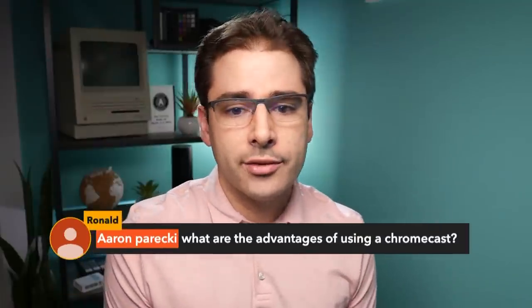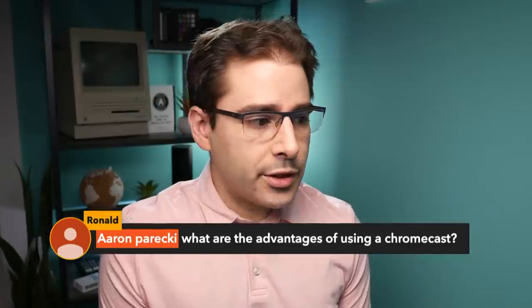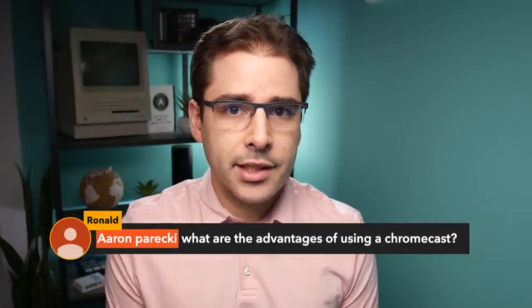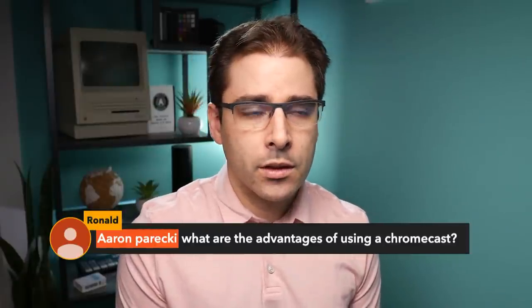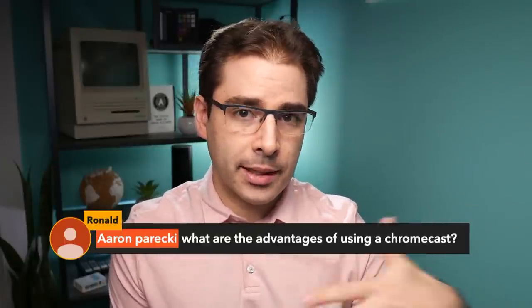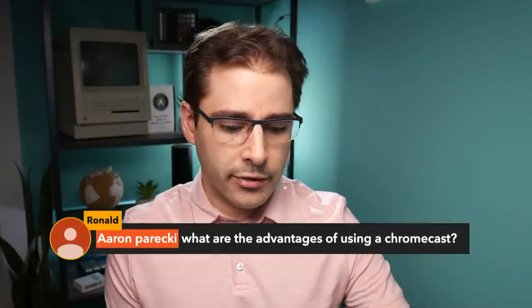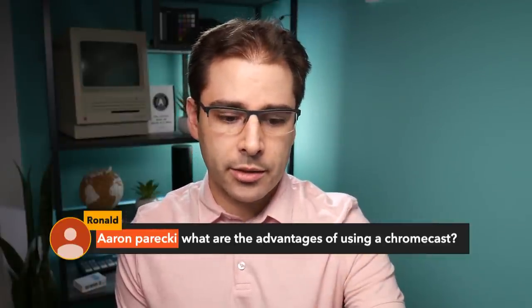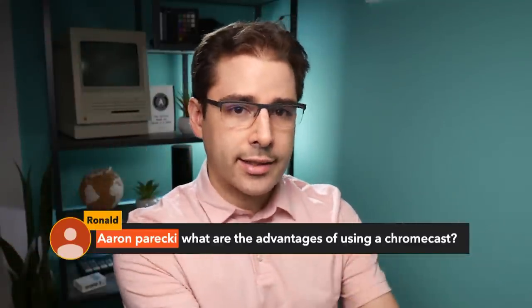Ronald says, what are the advantages of using a Chromecast? That's a really good question. The reason I've been using the Chromecast is because it effectively gives my computer an extra HDMI output. So I don't have to worry about my computer thinking it's an actual display, which sometimes gets hard to manage with that many displays. So my computer right now thinks there's only one external monitor, which is then mirrored to the physical monitor here as well as into the ATEM.